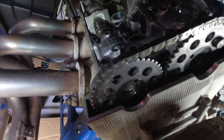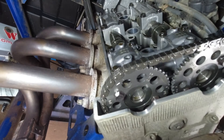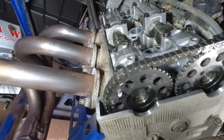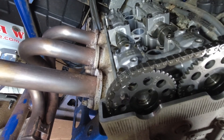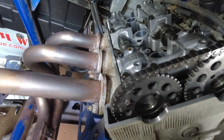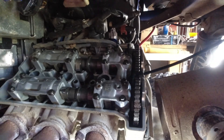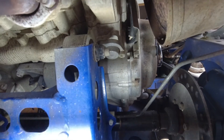What I've just done now is rotate the engine and I've lined up all the marks on the camshaft gear so they're all where they need to be. I'm just going to lock off the chain with a zip tie so it doesn't come off when I take the tension off and it stays put, and then I'm going for the timing chain tensioner. I've zip-tied the chain on to the sprocket just in case.